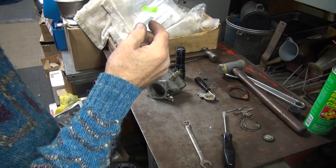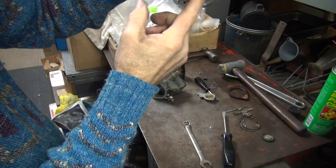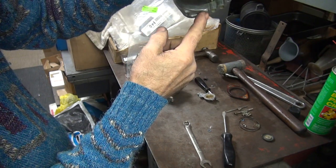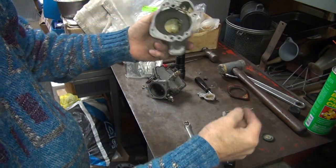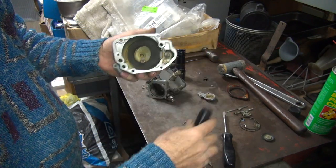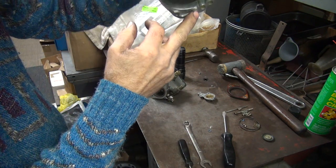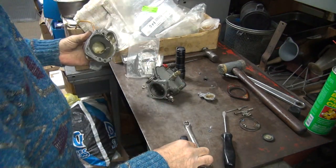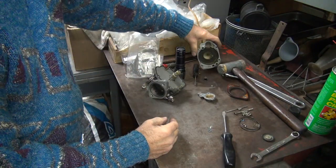Now the float height — you go like that, you see where it sits at. This one here is sitting pretty low. There's a dimension; I don't remember exactly what it is, but this one is about 7/16ths, which looks like quite a bit to me. If you want to give it a little bend like that, we'll go a little bit further down, get it closer, a little bit closer to 3/8ths. Looks good to me. Alright, take care of that part right now.